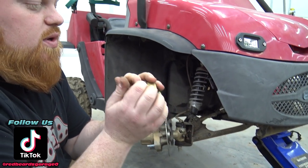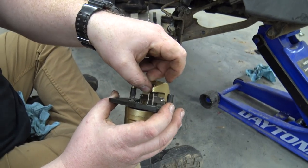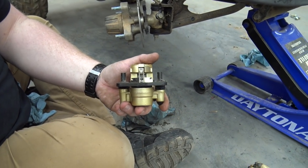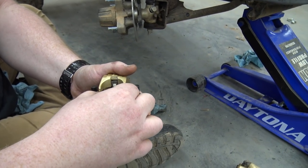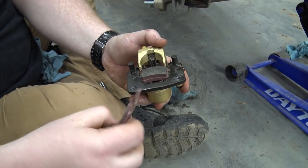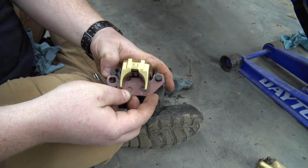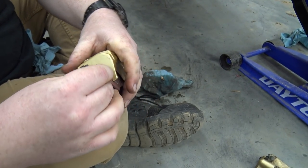I've already done the other side by the way. Put that metal clip back in there — get it behind the piston — then we can put the small pad in. Put the new outer pad, hook one side, rotate it in. This sometimes is a pretty tight fit.